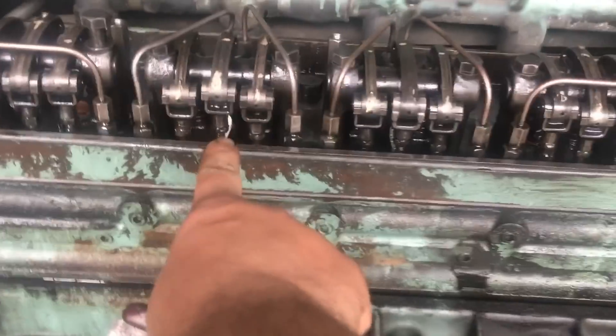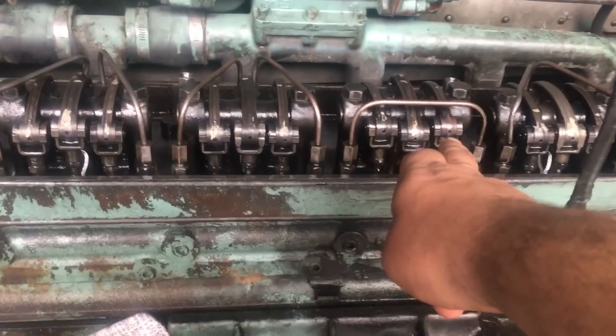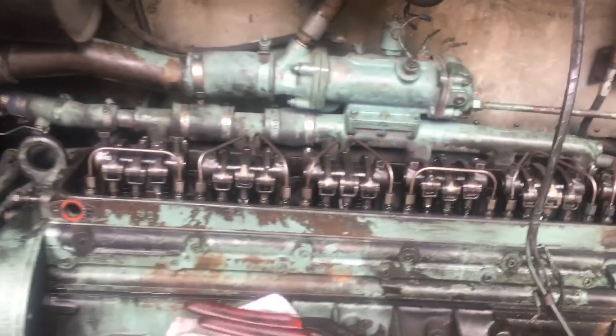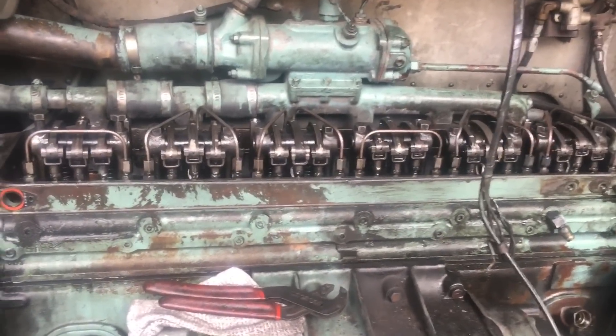Just over 300, just over 300, 400 — that's the one with the bad valves, the injector stuck. 400, 400 is my compression. So I'm guessing this one was probably weak for a while too, so I think three of the cylinders on here have been really weak and that's why this bus smoked so bad. It's been a starting fluid queen for a long time — even on 70-degree days they still had to start it with starting fluid.